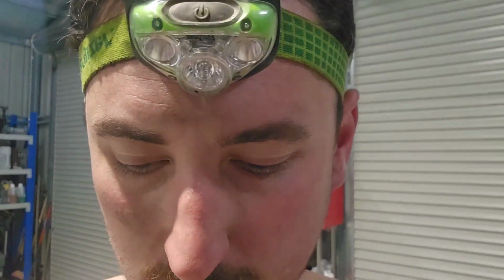But make sure when you put it all back together, because it will take you longer to pull it apart because all the extra bolts around the radiator shroud, I'd suggest only putting 4 or 5 bolts back in, particularly the corner bolts, and then maybe one in the middle at the bottom, because that's where that big changeover valve bolts to, and there's a bit more weight hanging off the bottom of the shroud. But the shroud's solid as. I've got 5 bolts in there and it ain't going anywhere.